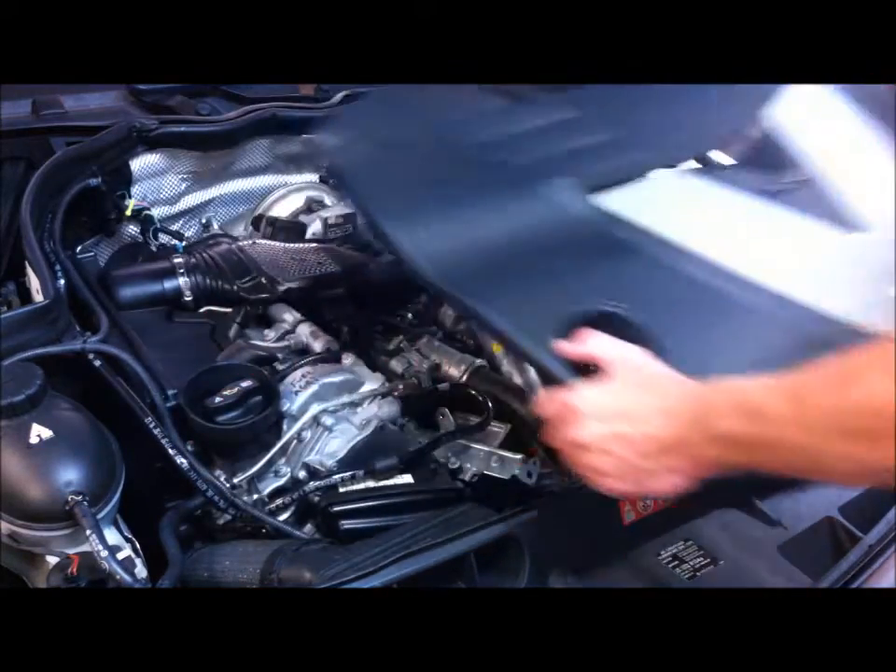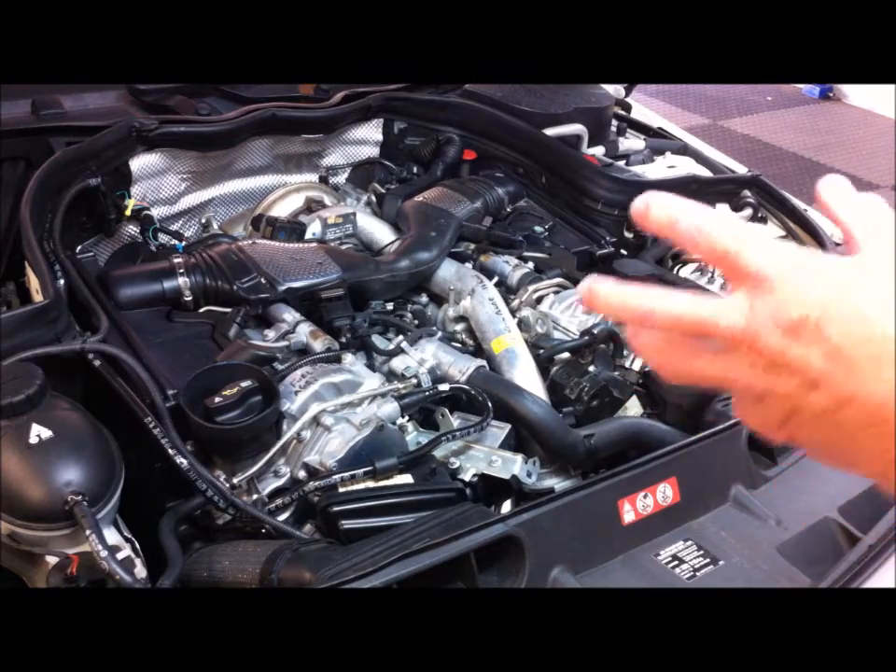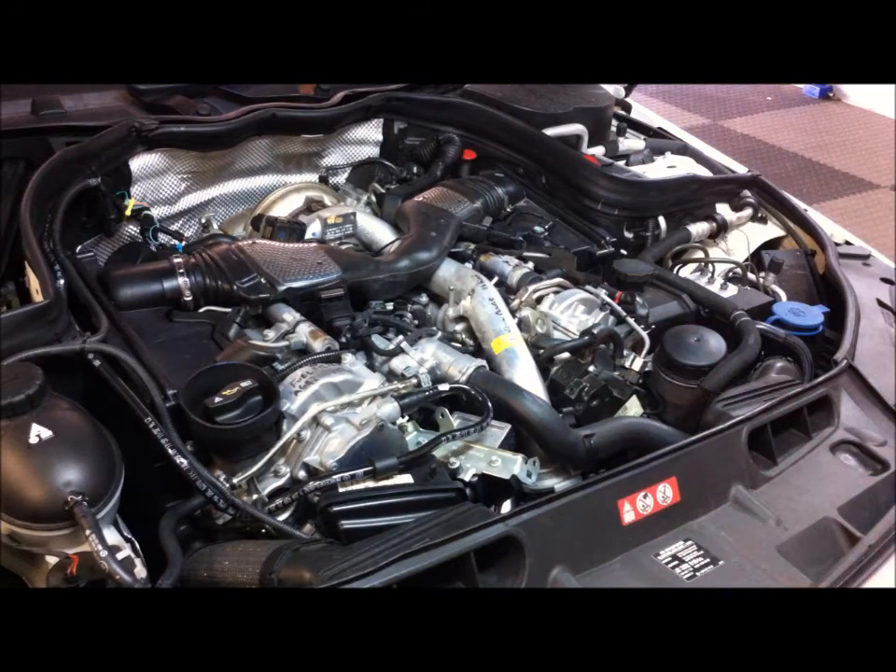It's fairly common apparently with the V6 3-litre diesel. I'll just take the cover off and show you what's happening. The way to test your engine mounts is to start the engine, put the transmission in gear, hold your foot on the brake, and blip the throttle. That transfers all the torque into the engine - it's trying to twist the engine.